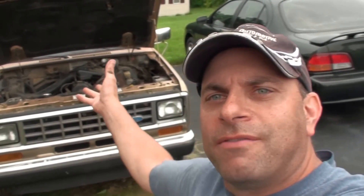Welcome to today's fun project. I've got an 87 Ford Ranger here with the 2.3 liter four cylinder. I get to go in it today and start it - push the clutch in, turn the ignition on, crank, no start. It's definitely cranking. We either have a spark issue or a fuel issue. I'm going to get the camera up under the truck and listen for the fuel pump. If we don't hear the fuel pump, we'll get to the next step and take it from there.